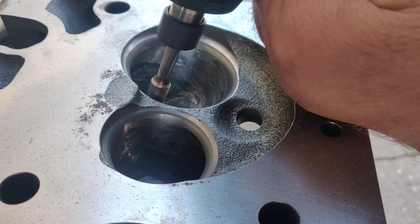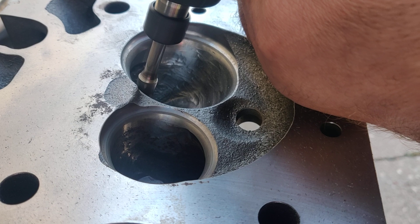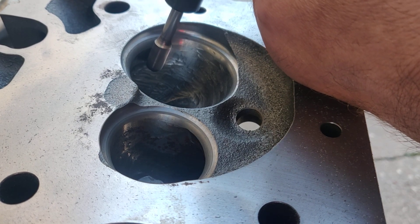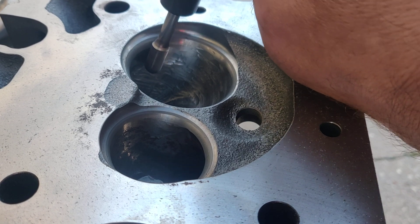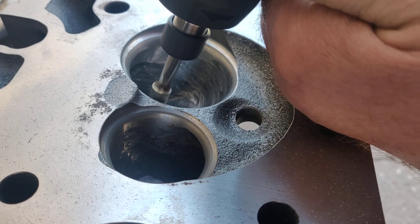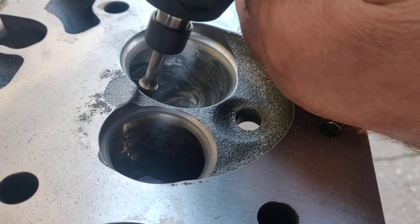You got to watch that seat — don't turn into it or anything. If you go pressing real hard, you'll get a lot of metal quick, but you'll end up screwing yourself. So use a nice easy stroke.